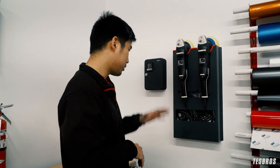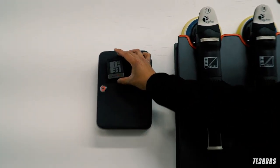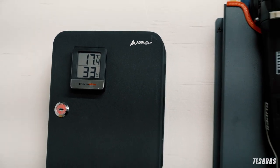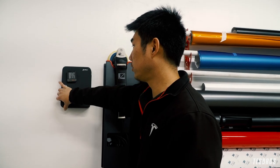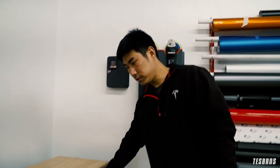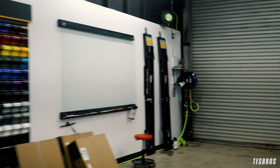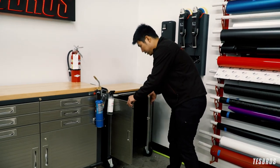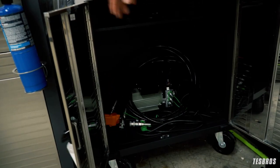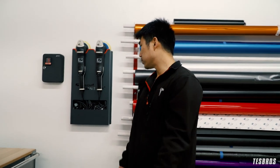All right, so day four or so of this. Just wanted to talk about what we've done in the past few days. We did install this key lock and we also have the temperature display — this is really important especially when we're installing PPF, so that we know how to make the solution for tack and slip. It also has humidity. We have all our keys in there, the Tesla key for Model 3 owners. Then we have this rolling cart — the reason it's a rolling cart is because we use quick jacks over there. It's really a big pain to get the hydraulics up and rolling, so we have this cart nicely packed with the motor, connected with quick connects, and all our accessories are in there. Whenever we need to lift the cart, all we need to do is just drag it around and connect it — super easy.